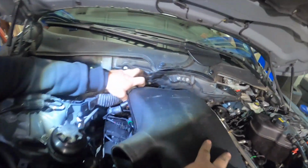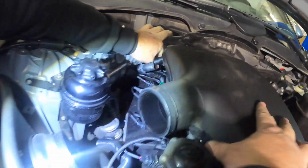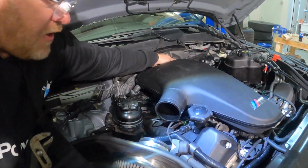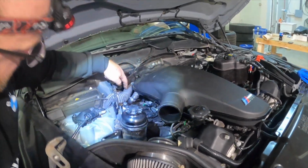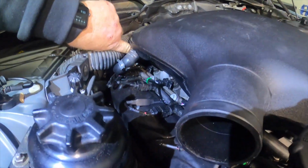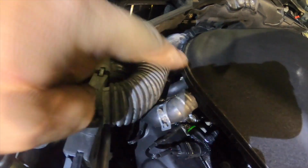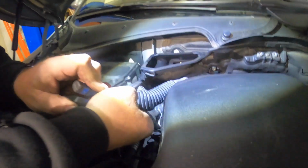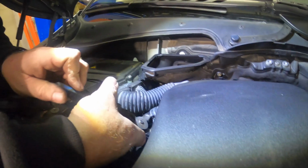While we're doing that, and before we do that fully down, we need to get our vacuum lines firmly reattached. So just as a reminder, we'll show it to you over there, but you have the plenum connector in the back. You have this push-on little guy here, about a 1/2 inch. And you have the 1 inch guy right here. Get it up over there. It's a pretty tight fit.